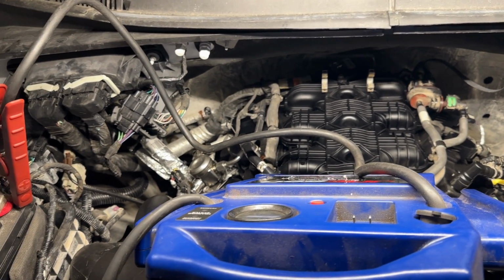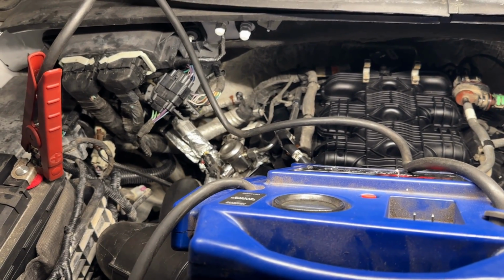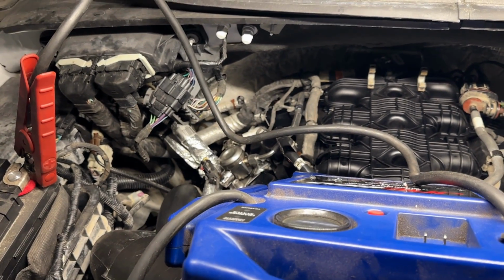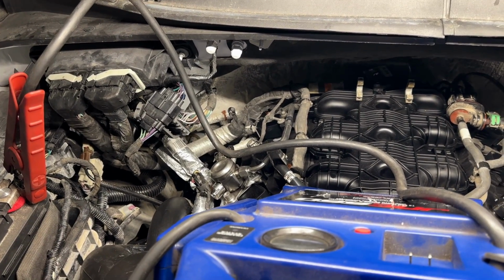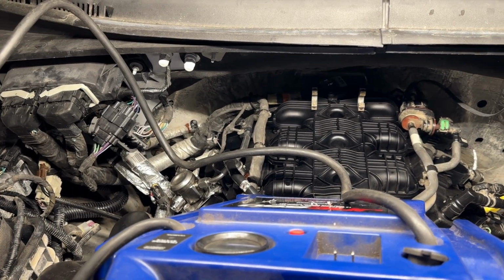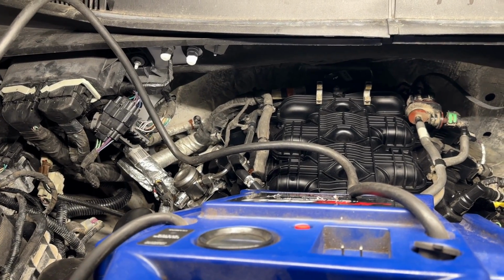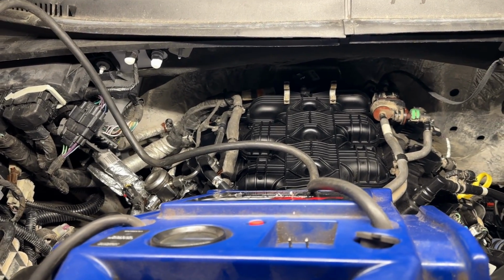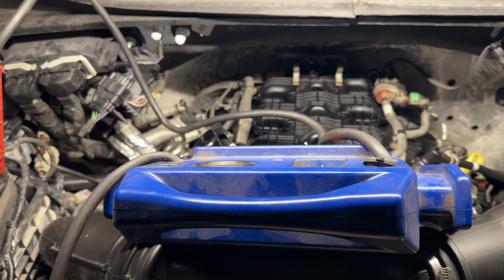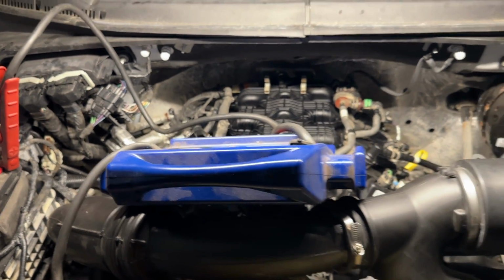It's a very important step whenever you're replacing just about anything having to do with the crankshaft. So a new engine, dampener, trigger, anything like that. When you pull and separate the transmission, change the flex plate, anything to do with that, you change the trigger wheel, crank sensor, any of that stuff, you want to relearn the misfire profile correction, or else you're going to have ghost misfires. So I'll show you guys that before the test drive at the end of this video.